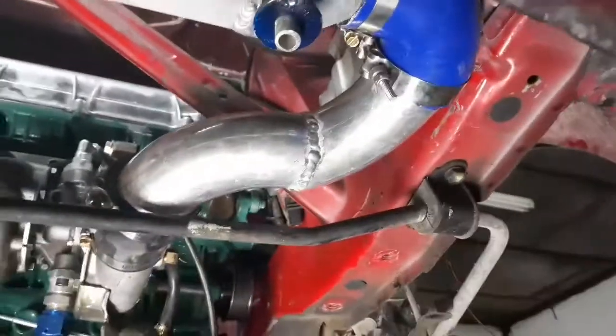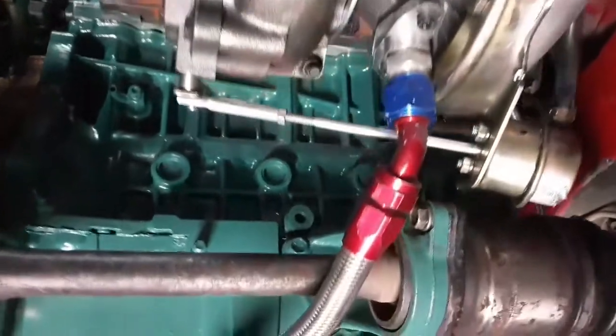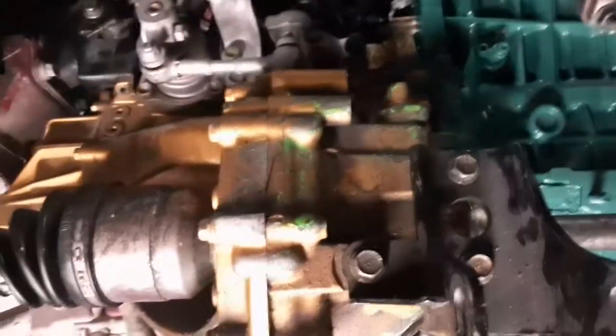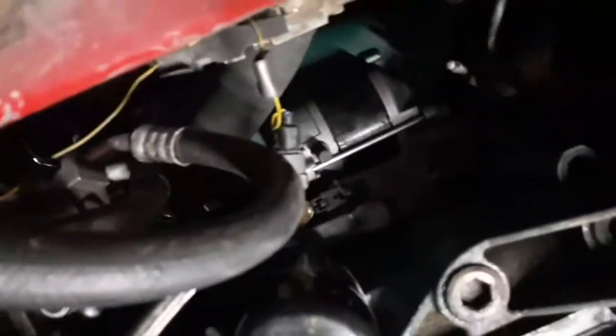Here's my pipe fully installed. I got all my clamps in there — it's not touching anything, so that's good. I took my engine out and painted it Volvo green — pretty epic. My transmission is steel gold. I also put a little plastic clamp right here bolted up to one of these bolts, and it keeps my line from touching anything and coming loose.